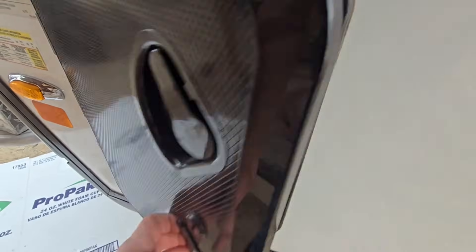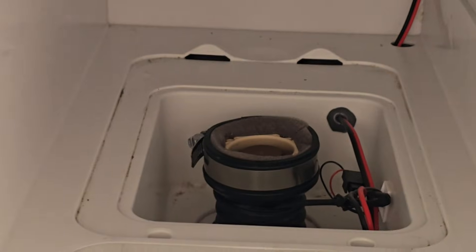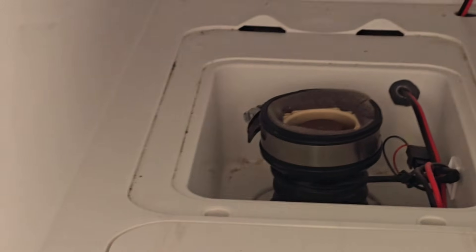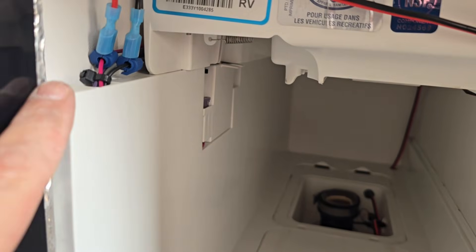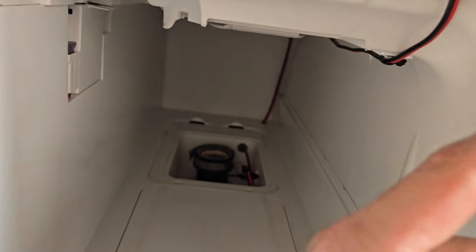Quick recap for everybody when I made that fan — here's how I did that. I came in here in the back pocket of the cassette and I sliced a very small piece of hose off the end of this lid here that was on there. And I replaced it with that weird rubber coupling for plumbing. And what I did was I put a small computer fan in there, and that coupling fit down in that existing vent hose and around my wiring — tapping it to power over here running a fuse, around my wiring back to the fan and then up through the toilet to a switch.